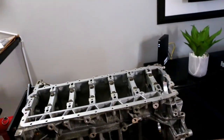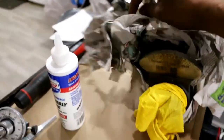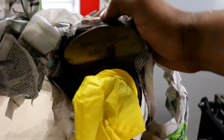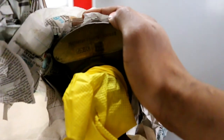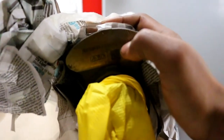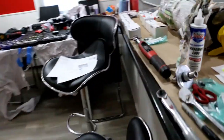If you know anything about these N54 motors, you know they're kind of complicated. There is a stamp on the crankshaft — you're going to have to remove your oil pan to see the crankshaft — but there's a series of numbers etched into the metal that indicate what bearing colors you should be using. And also for the rod bearings, you can barely see them.